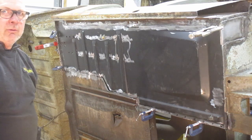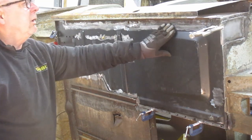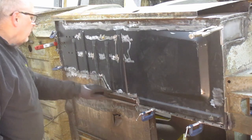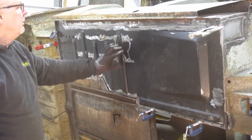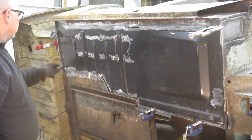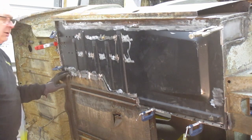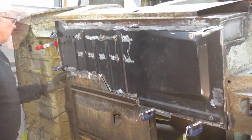I'm quite happy with how this has turned out. My joints are all going to work quite well — everything's lined up. I've got my plug welds going along here, butt weld there, and I've got my holes drilled along here so I can plug weld those in there. All my joints are tight, except for this little bit at the back here — I'll just have to put a couple of plates in there. I've got some holes punched in both panels, so I'll plug weld that piece in there.